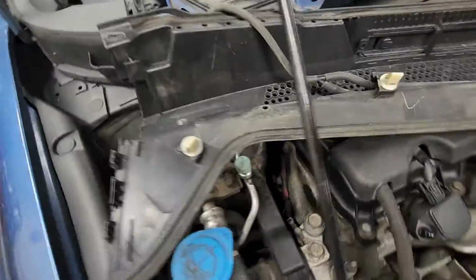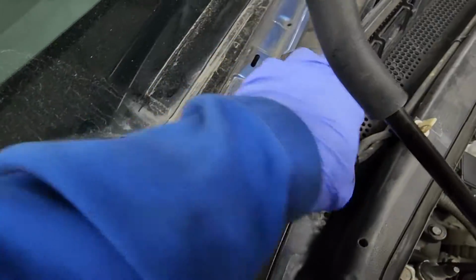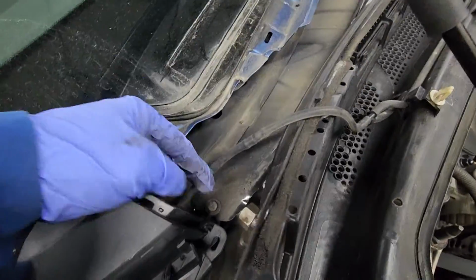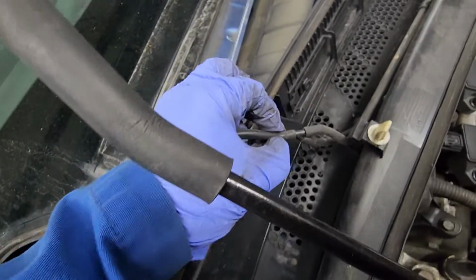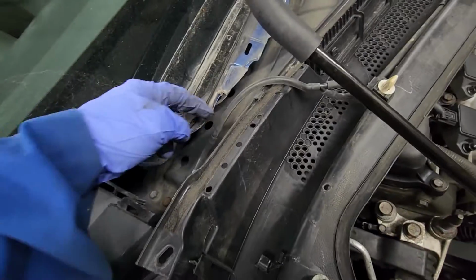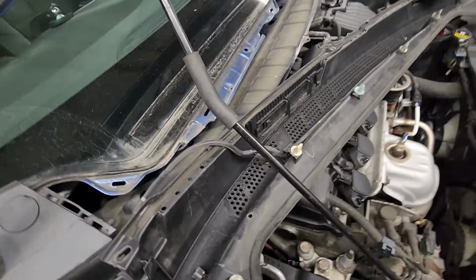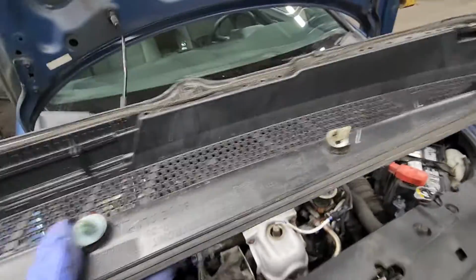you wanna, this is for your washer nozzle to feed the washer fluid. So take it out of this hose, this line right here, just pop out the hose. I'm gonna need 2 hands to pick at it, but yeah, that's what you need to do. Alright, so once you got that out, just like that, so right there, now you can take this piece out.